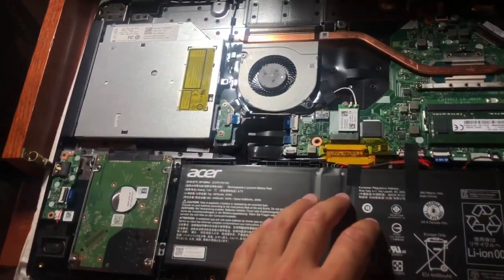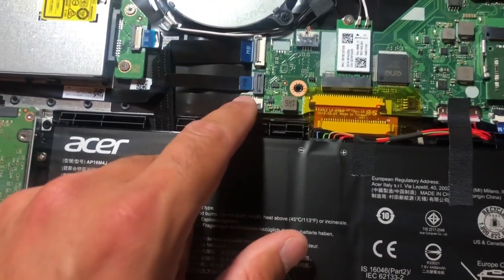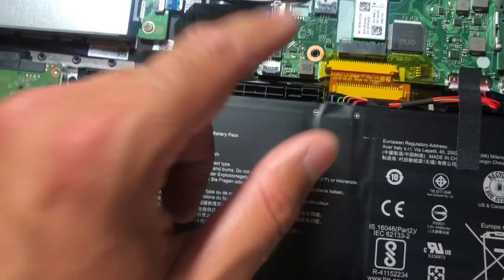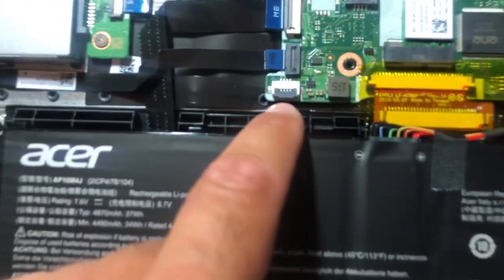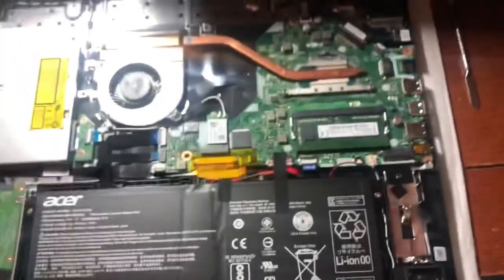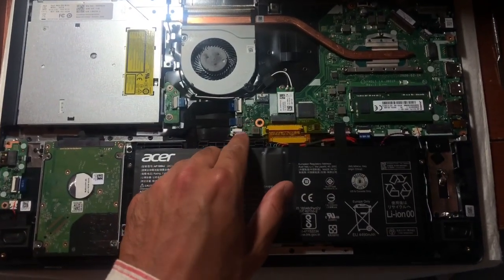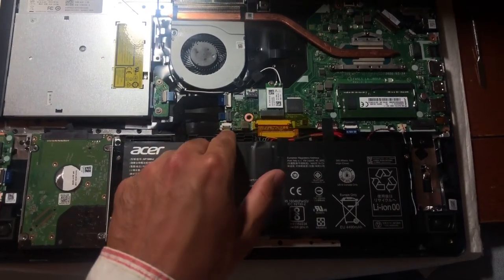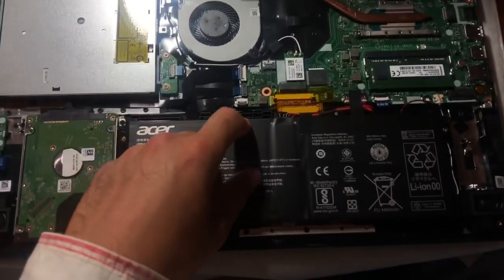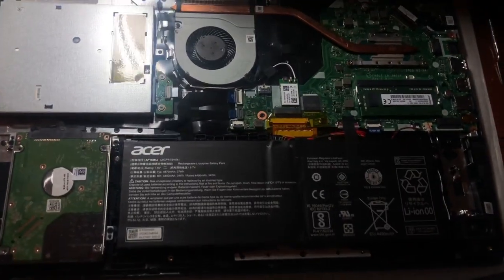This thing has a 1 year warranty. So I'm not gonna go there, but I'm gonna show you. That's the plug. So this laptop came with the backlight optional plug. So this is a backlight-ready laptop with the option of plugging it in, but this didn't come from factory with the backlight. So this is the plug you want to find when you open your Acer Aspire 3 on the A317-52-569E models. Pretty much that's how you find out if you have a backlight plug. So if you ever buy a laptop without a backlight keyboard, you have to first open up the back or call your brand's customer service. This was Acer, so if you have an Acer, you call Acer customer service and you ask them before you even take this apart.